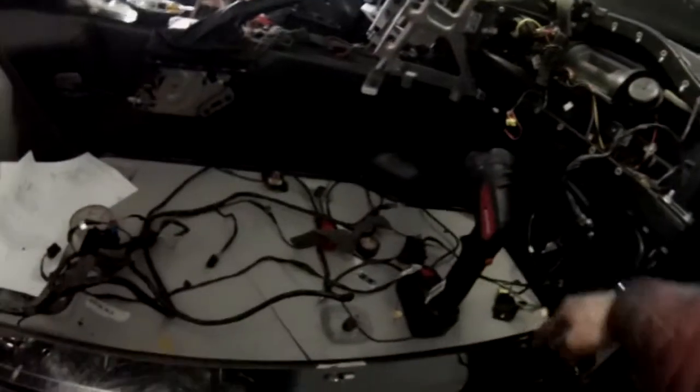If we go and look at the back, this is where the roll cage frame is going to come, and that's where I have to cut to put the plates for the back of the roll cage — the fiberglass will have to be cut there. On the inside I have to put the plates here. Multiple plates are going to support the NASCAR door bars. The frame is just behind the B-pillar, so we can't put anything on the floor there. We'll have to cut an opening to put the bar, which will go straight for the main hoop and be welded directly to the frame.